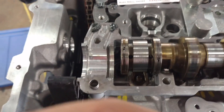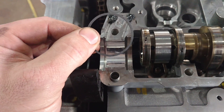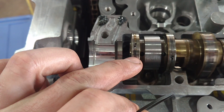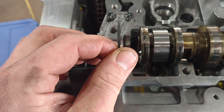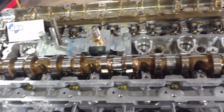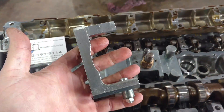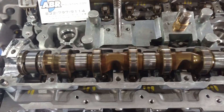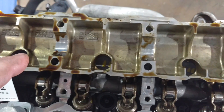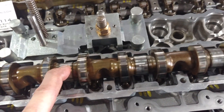The way they fix that is by going to these updated rings, which are made of like a phenolic or heavy plastic essentially. We remove the old blocking rings and replace them with these updated plastic rings — they ride where those guys used to be and they won't wear the cam tray out. Now this is a very involved job. There's special tooling involved, and there's even a jig you have to put around these cam trays in order for them to properly be aligned. They run all up and down this whole tray and accurately align it because the bearings ride directly inside these trays. If the trays are misaligned or improperly treated, the bearings will be damaged.